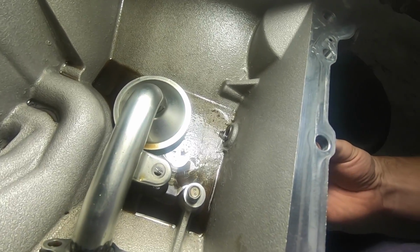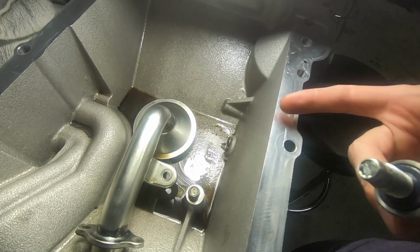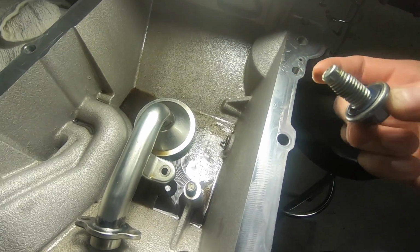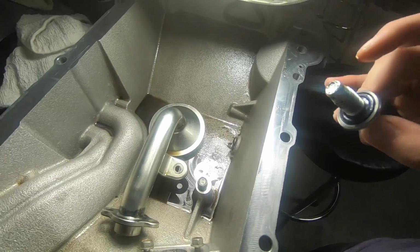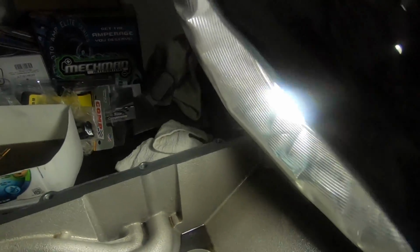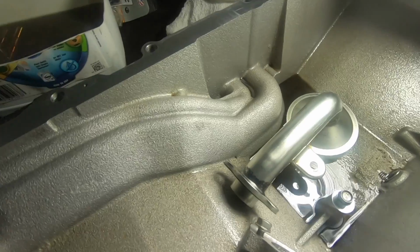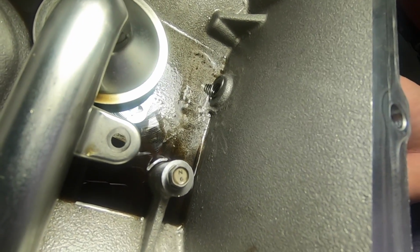So now what we're gonna have to do is figure out if that's something. Obviously I could take the old heli-coil out. I just need to figure out what was put in there from the factory, so we get the right size heli-coil to match up with the cut threads. And hopefully it's a standard size. It's not some weird GM proprietary heli-coil thing or something. So that's probably something I'd look at quick, just pulling the other bolt out and seeing, but I'm just not even sure you'd be able to see that. Because if it's inserted properly, you shouldn't really be able to tell.